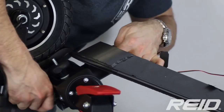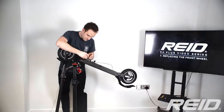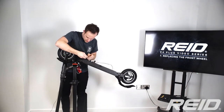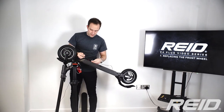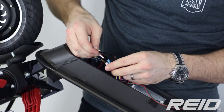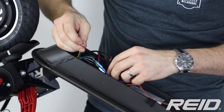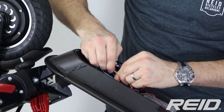You can immediately see it coming through — very easy to get through. Then untape it and reconnect: the white clip for the speed regulator, and then the motor connectors — remember blue to blue, yellow to yellow, and green to green.